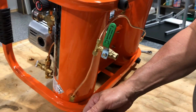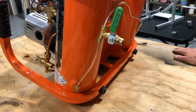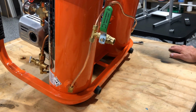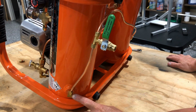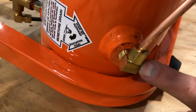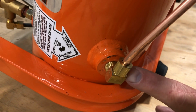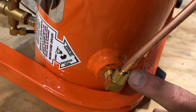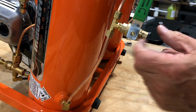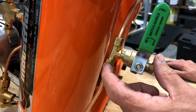But Edwin, say a guy wants to buy these parts on his own. What parts is he looking at buying? Okay, so basically we're looking at 5 parts. So this is an NPT by compression 90-degree elbow. So it's 1/4 inch NPT by compression, and this is 1/8 inch tubing. Copper tubing. NPT by T.